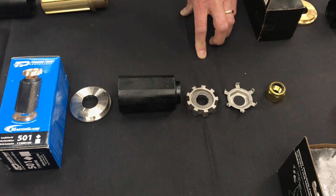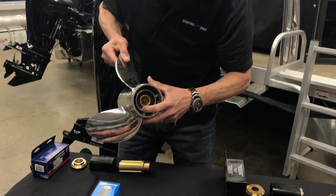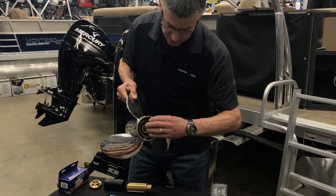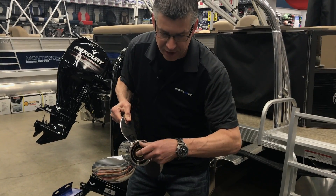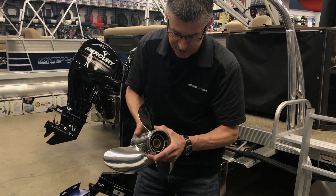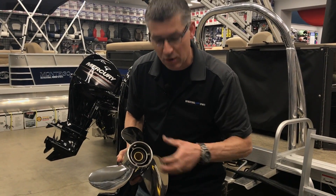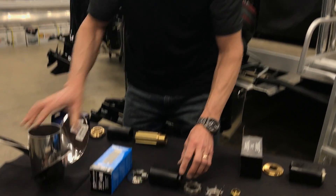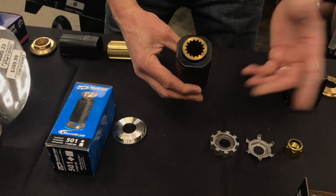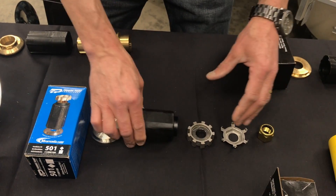The other reassurance you have now is because the old rubber hub is round, sometimes from old age and exhaust the rubber would wear down and you'd actually spin and catch and grab and catch and grab — you'd think it was your gear case or the drivetrain, but it's not. It actually was the rubber hub grabbing and letting go. With the new style of hub kits now being rectangular or square, you don't have that problem anymore because either they grab or they don't, which is awesome.